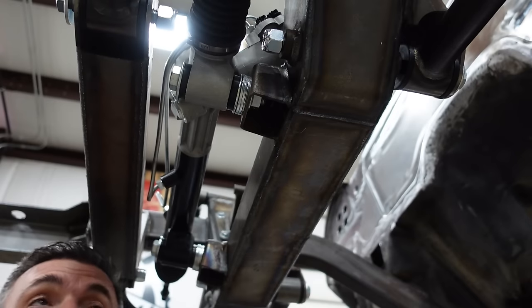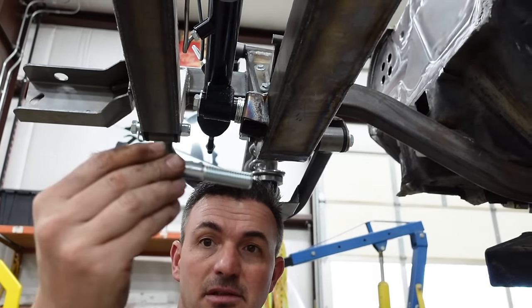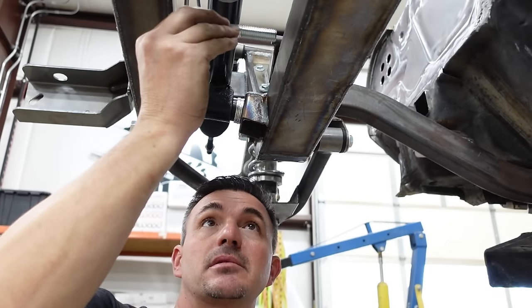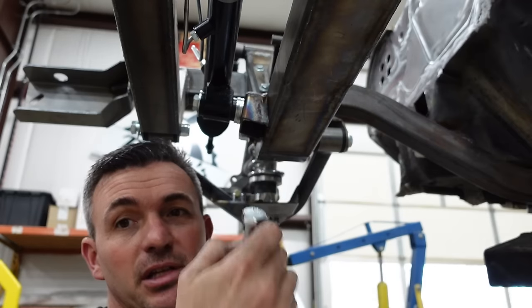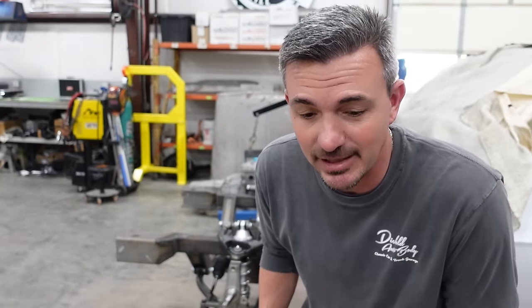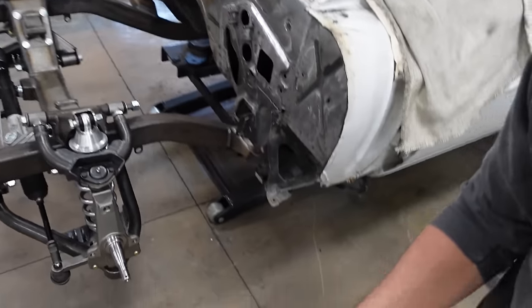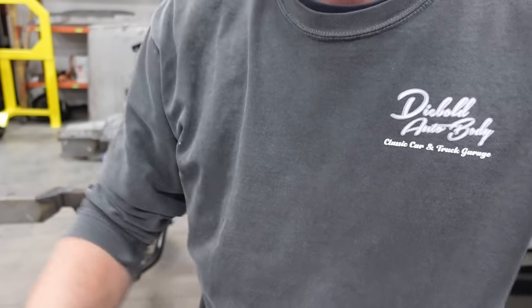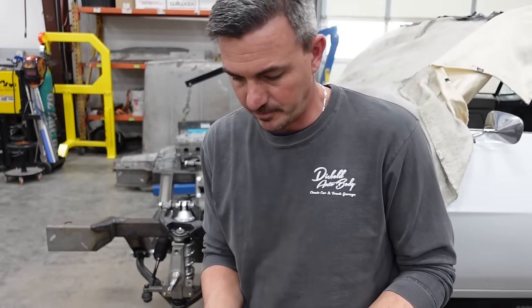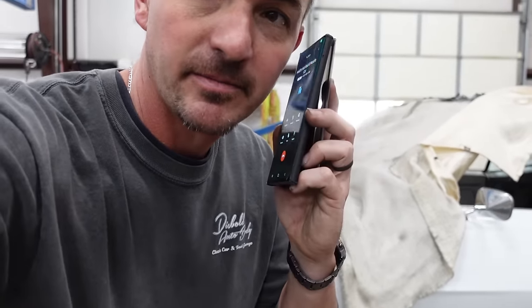The issue is there's not enough room for the bolt they supplied — it just doesn't work. I dropped to a different bolt but then couldn't get a nut on when I shimmed it out, so I used washers to shim it instead. I called Frank over at Heidts and told him the situation. He said they've been having a problem with that steering arm and are working on a redesign. And right now Heidts is actually calling me back.